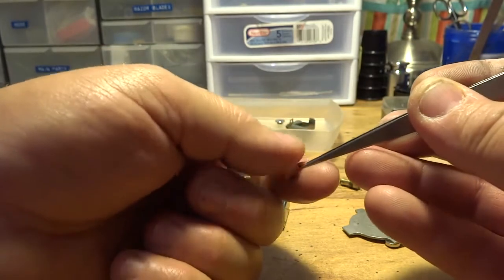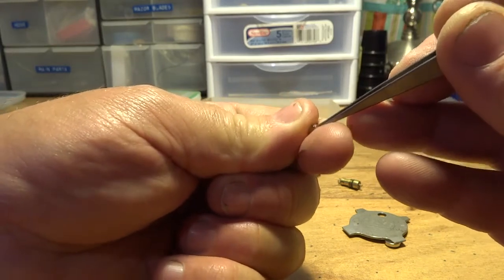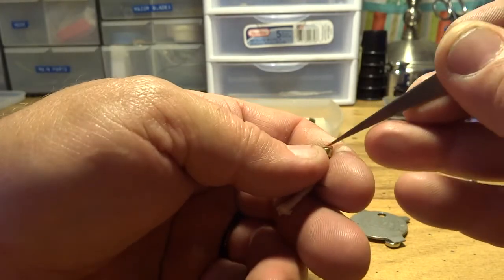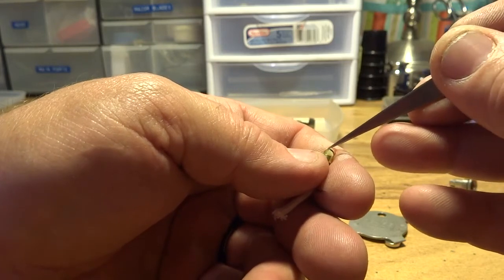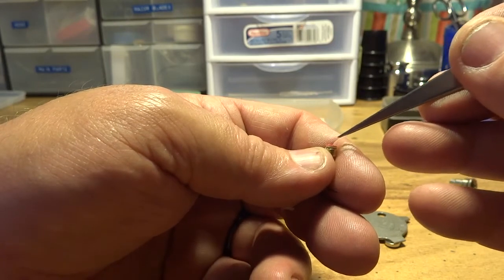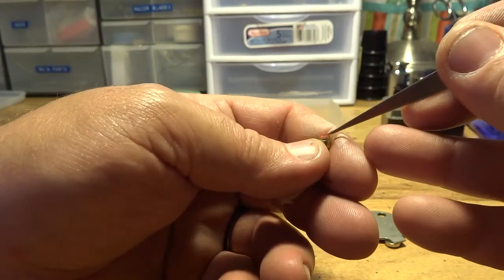until you can pull that piece off. See that little metal backing plate? Don't try to force that off, because I'll tell you what, this backing plate I got on here on the back of this pressure regulator isn't the original one, because I got in a big hurry and I broke the little brass piece off in the original one. But you know, I got this one here and it works just as good.